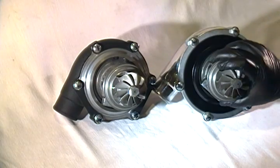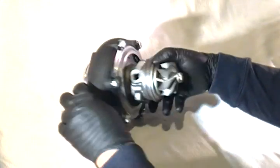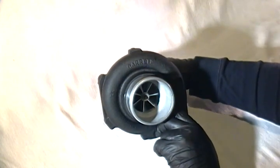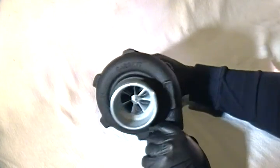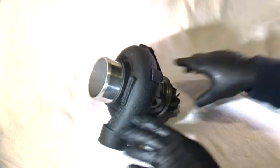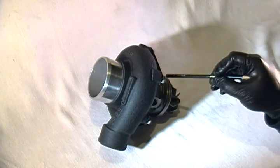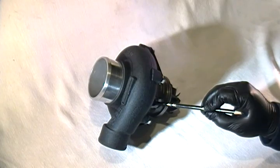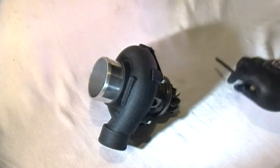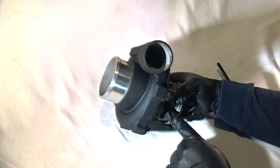For the composition of the turbo, it's straightforward. It uses the same T04B compressor cover shared with the Silver Surfer and Hunter, a T6 7075 aluminum compressor wheel from SpeedTrap, and a full genuine Garrett ball-bearing cartridge using a 7/16 by 24 inlet and 14 millimeter water fittings, which are required for this turbocharger. It uses the GT flange style on the outlet end.